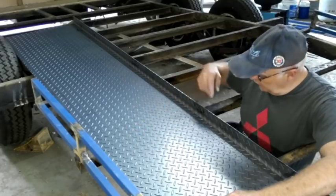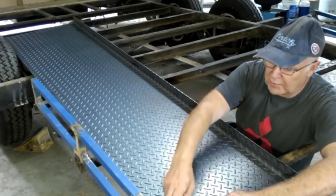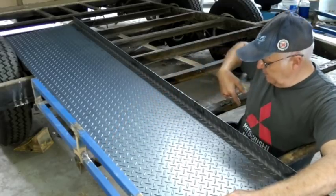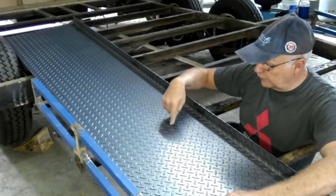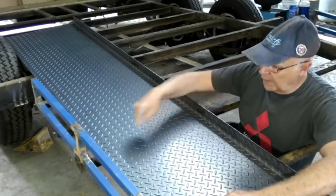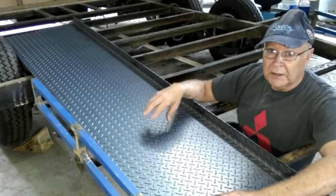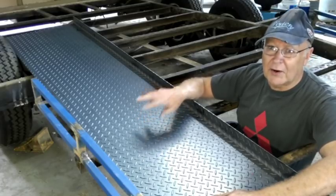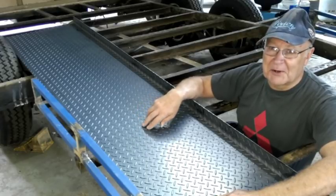The method I'm going to use is to put edge welds where the cross beams are on the frame of the chassis, and then where the cross beams run underneath the floor, I'll drill out large holes about the size of my thumb and plug weld it. That'll give me very strong adhesion, and the good thing about plug welding is even when you're a crap welder like I am, they're strong and you can make them look neat.